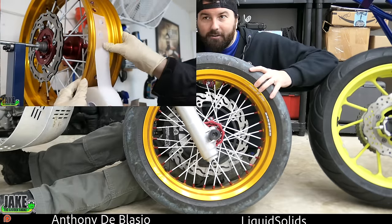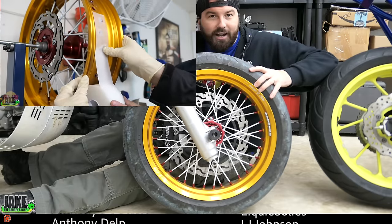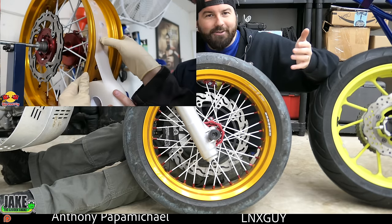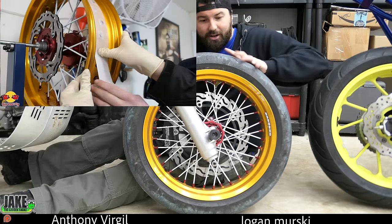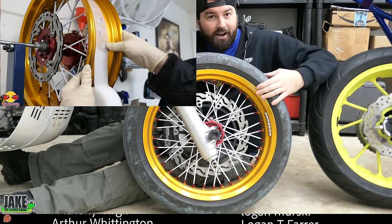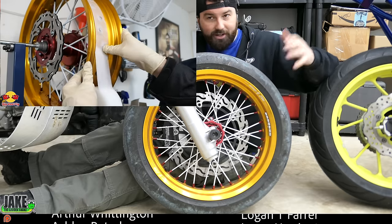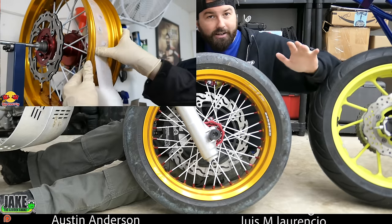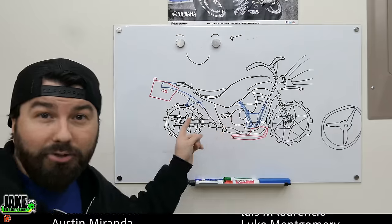When we initially filled them up I had them aired up to like 45 psi and left them sitting until we finally went to ride. I think I rode it the first two times and forgot — they were still that high. That was just to see if it would hold air. It was fine. The only time I've ever had to air these up is when it gets really cold and both bikes lose a little bit of air. If you do it right, I know this works.